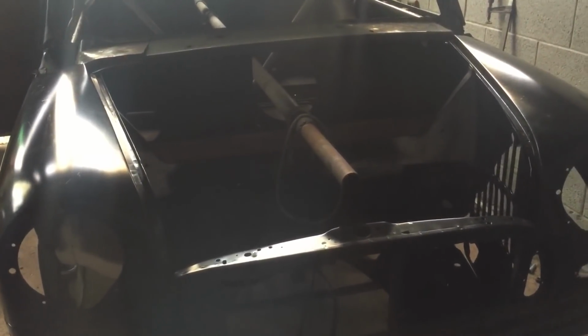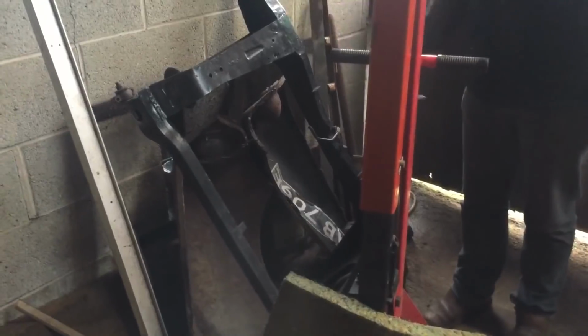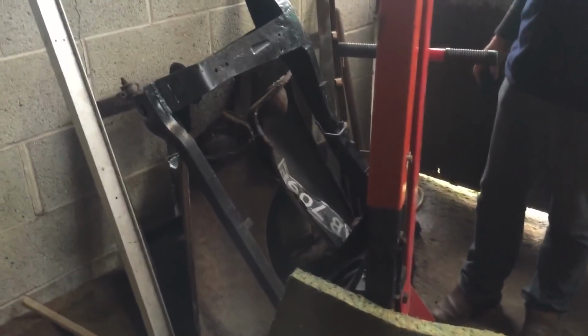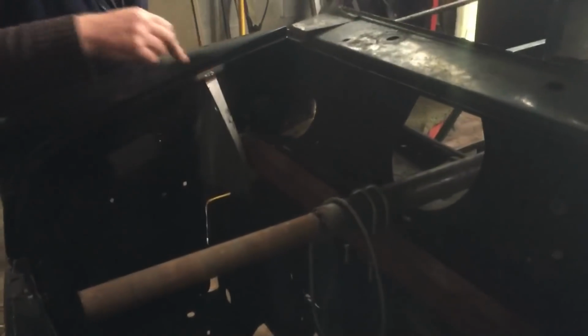Yeah, because there's no rush for this. I've got all the bolts out of this subframe, so this is usable now, and I've repaired it. That front subframe's all repaired. Holes here and this bit here to do. So the bulk of the rust is gone now, isn't it? It's just getting everything positioned before you start welding it up. But I'm not going to weld anything until I've got this in. So I can get that in and just tacked in position.